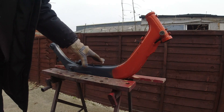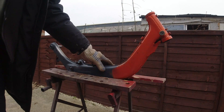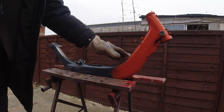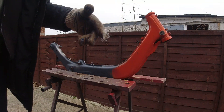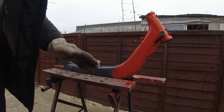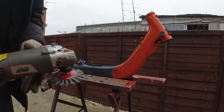I thought it was going to be quite deep but everything's come up quite nicely. I went back to bare metal on this half, two thirds, and then quickly went over with some Acid Etch Primer just to protect it. Today I'm going to try and get this off and then give it some Acid Etch Primer, and then get on and do the forks and the back subframe area. Hopefully we've got something we can start putting back together. It's all a bit of a mishmash at the moment — I'm not quite sure in which order to do everything — but I'll just show you how useful this brush is.